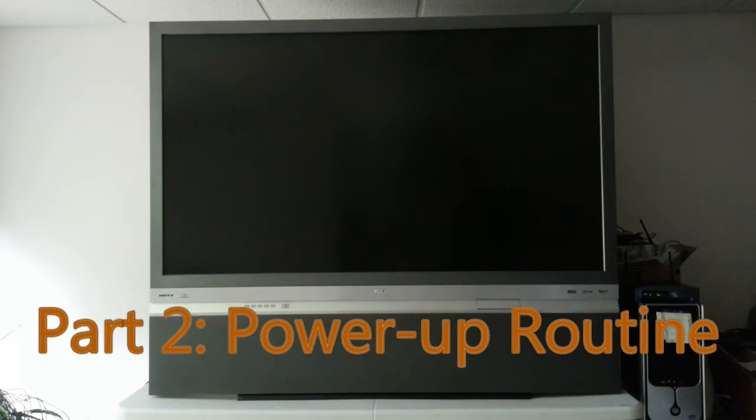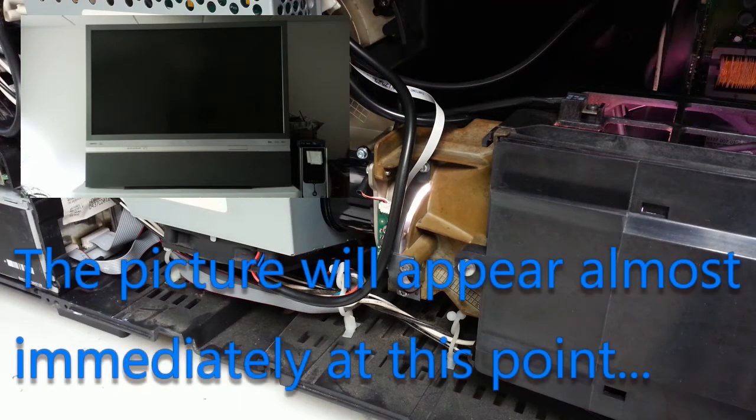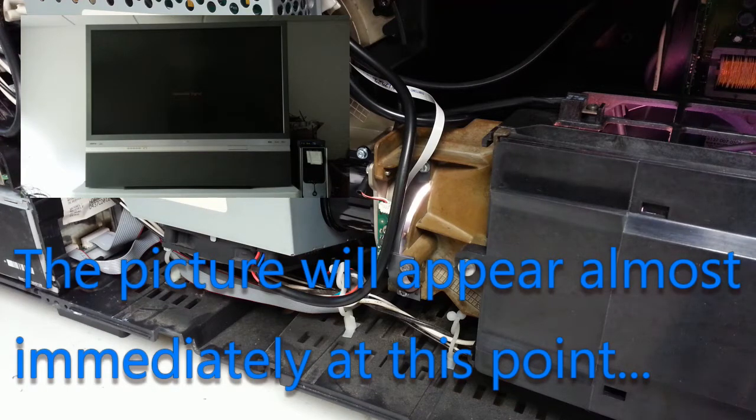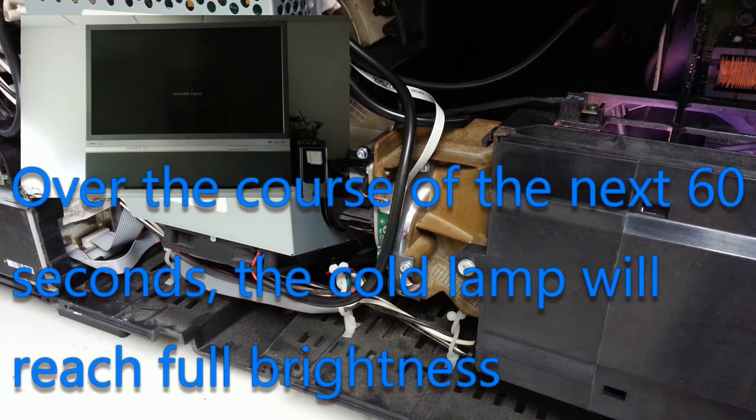As I learned the hard way during my repair experience, having an accurate diagnosis helps speed up the process immensely. So I'm just going to talk through the startup routine here for easy reference. Immediately after the power key is tapped, the green light comes on solid, and then nothing happens for a few seconds. After that, the sound will kick in, then the unmistakable whine of the color wheel will be heard. At almost exactly this time it'll attempt to light the lamp, and once it believes the lamp has been lit successfully, the cooling fan will kick in a few seconds later. If you're running into problems getting the thing to boot up, listen for what step it's getting hung up at and diagnose accordingly.